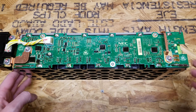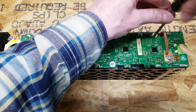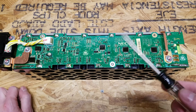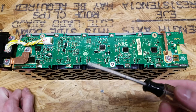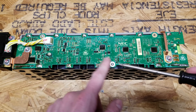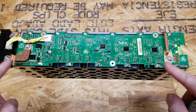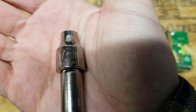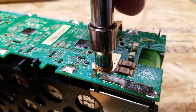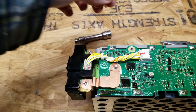The easiest way to get started is to remove three Torx screws first — they're all T10, which is nice. This PCB appears to be coated with conformal coating, which helps prevent moisture from causing oxidation. Be extremely careful where you're sticking the screwdriver and avoid dropping screws on the PCB. Next, remove the four bolts that secure the bus bar — for that you'll need a 7mm socket. Then you can pull out the copper bars and set those aside, and pull out the connector.